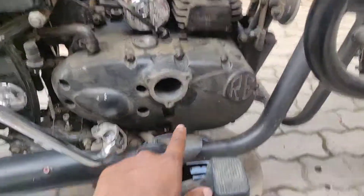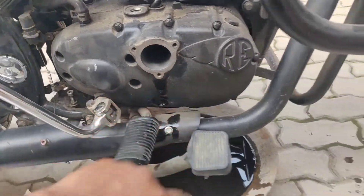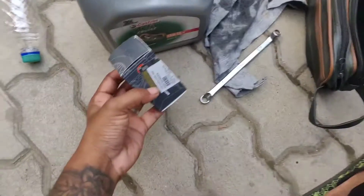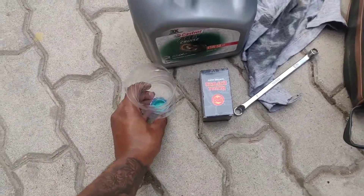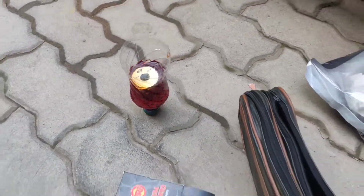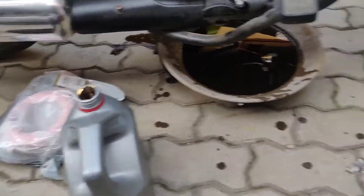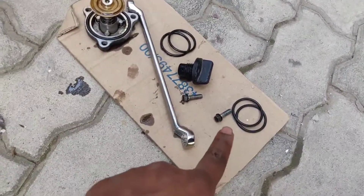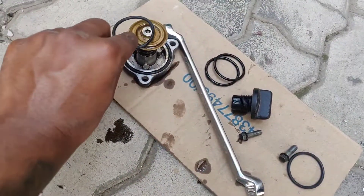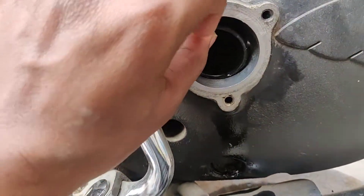All that is done. I've cleaned this part of the residue oil, and as you can see, there is no more oil coming out of the bike. I'm going to close all the screws down and then soak the new oil filter. The new oil filter is now soaked. I've screwed in the bolts, and these two extra bolts came along with the new oil filter — this one goes on top and the other one goes inside.